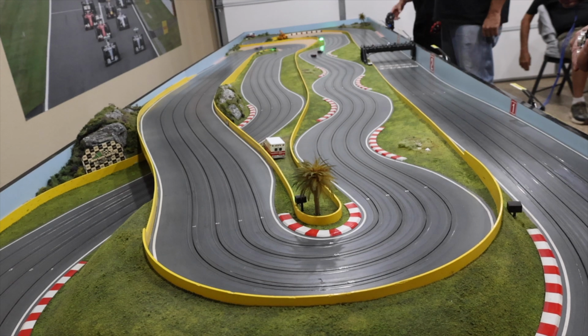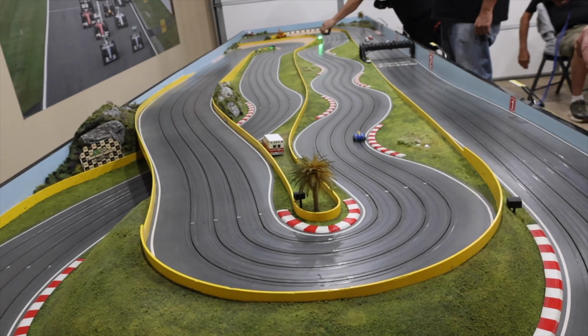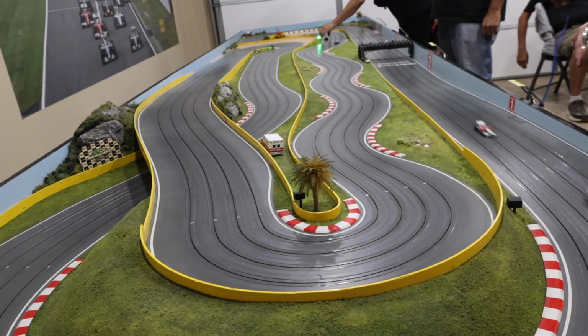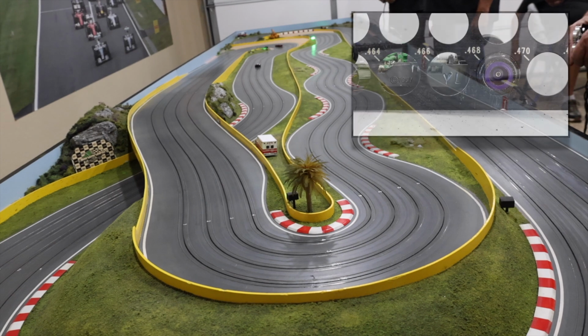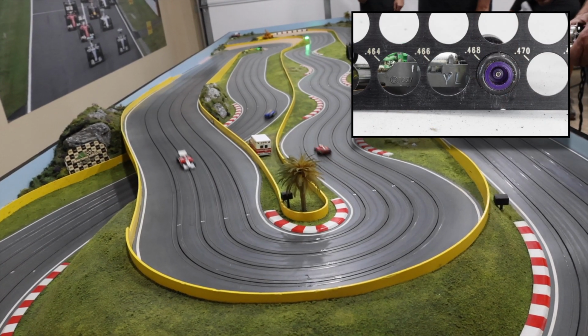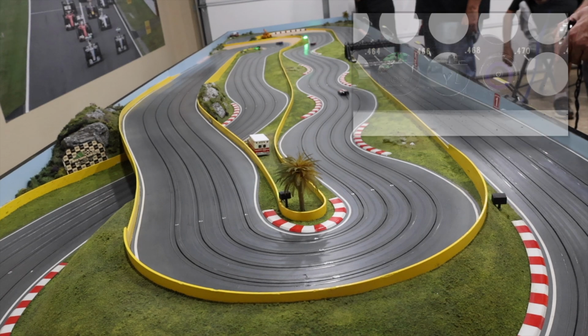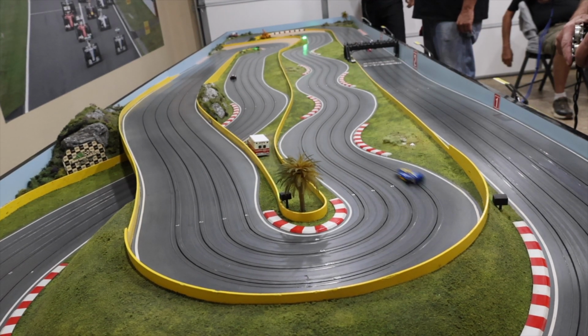When you're racing a car that relies on magnets for downforce, one of the most important items in tuning that car is the tire diameter. In general, the taller tire will give you more top speed, the shorter tire will give you better handling. Turning faster lap times is always a balance between top speed and handling.